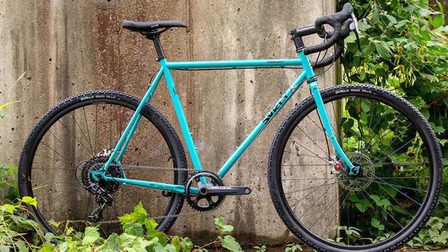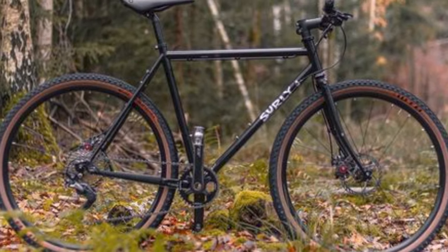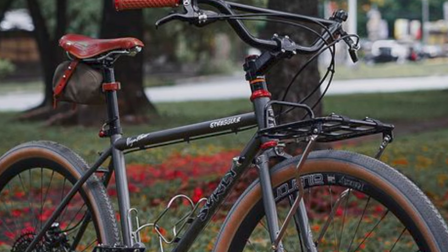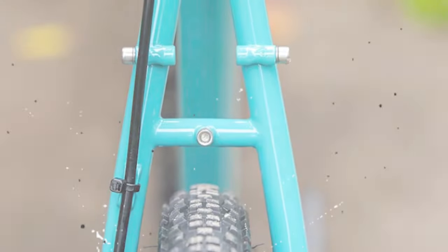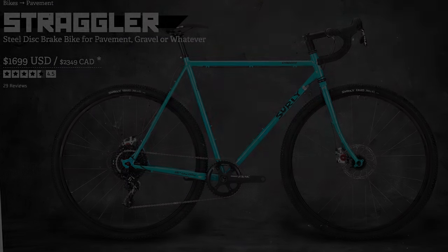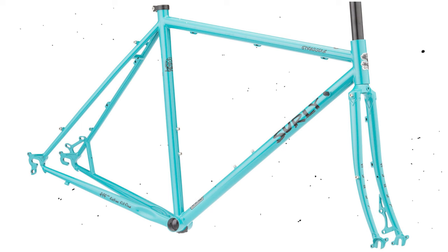Next is the Surly Straggler, a steel disc brake bike for pavement, gravel, or whatever. It's a bikepacking-inspired road/gravel bike, mostly at home on pavement but ready for trail duty. Surly describes it as a mountain biker's road bike — if you only have room for one bike, the Straggler can be your one and only. It handles Surly's 8 and 24-pack racks for heavier loads, has clearance for 650b by 41mm or 700c by 41mm tires with fenders, and comes as a complete 1x11 SRAM Apex build with SRAM Avid BB7 mechanical brakes for $1,700. A frameset is $650.